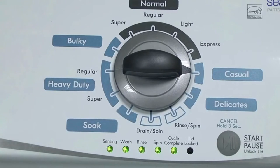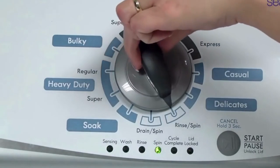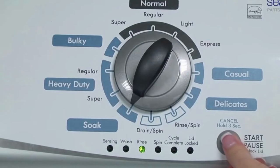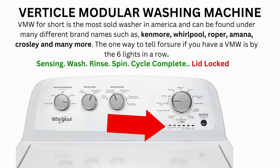All the green status lights blink when you successfully activate the diagnostic mode. If the status lights don't blink, try again — maybe try turning the knob a little faster or slower. Congratulations, your washer is now in diagnostic mode. Turn the dial 2 more times to the right, then press Start and you're done. The calibration cycle will begin and runs for 2–3 minutes. If the calibration cycle ends successfully, the lid unlocks and the washer shuts off. If it doesn't complete, you will need to pull the error codes to find out what's wrong.